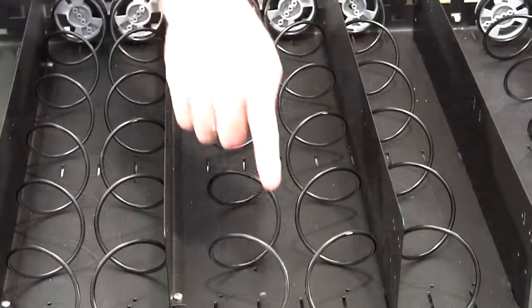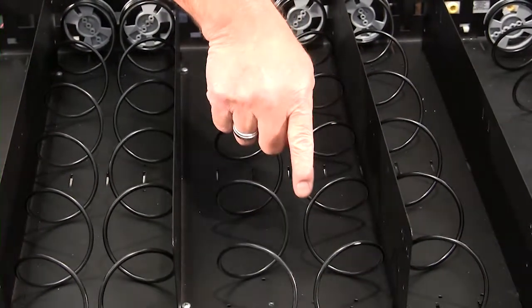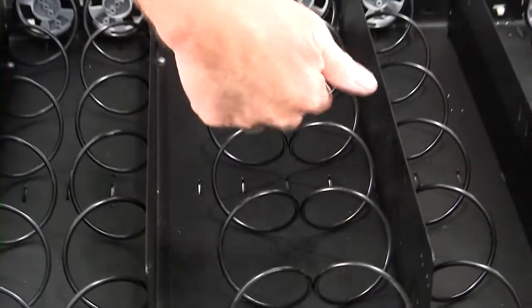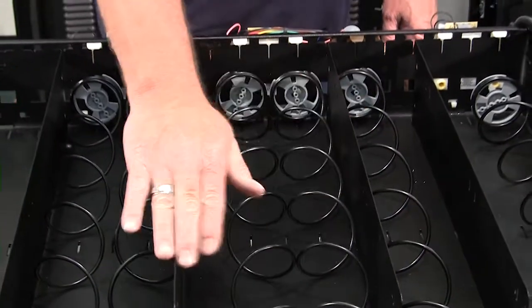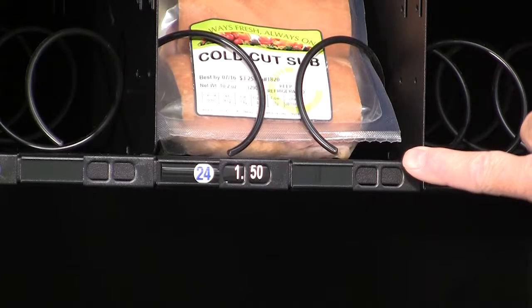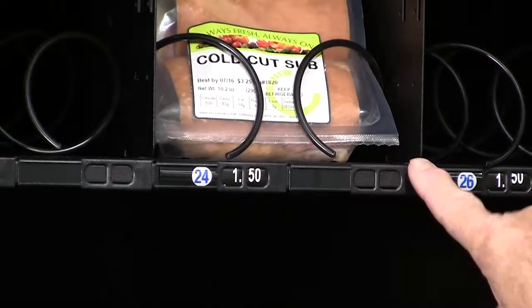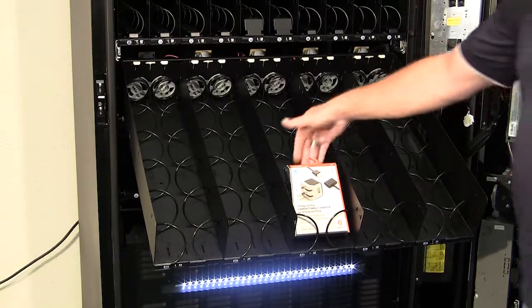Line up the spirals correctly like so. Spirals should be facing forward, keeping the vended items in. Coils facing backward like this can cause a jam. Looking from the front, the left hand spiral rotates in a counter clockwise direction and the right hand spiral in a clockwise direction. The dual spiral motor is recommended for vending larger items.